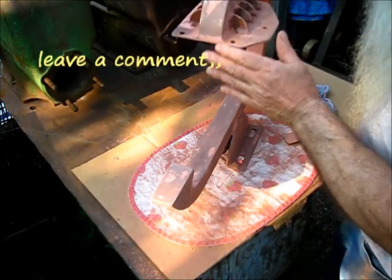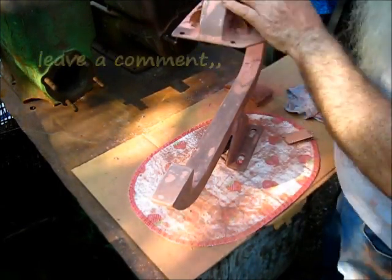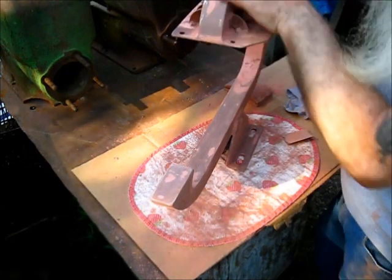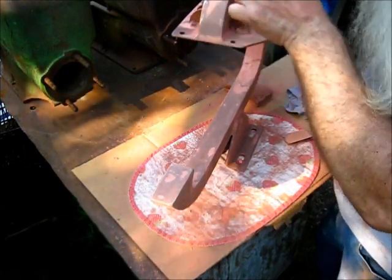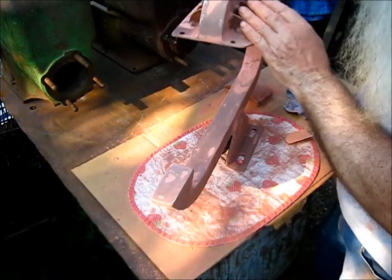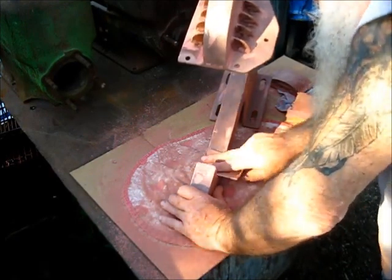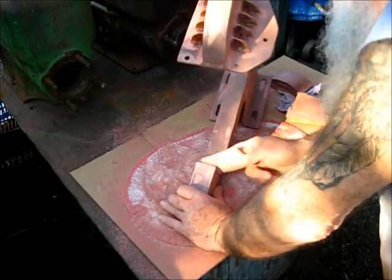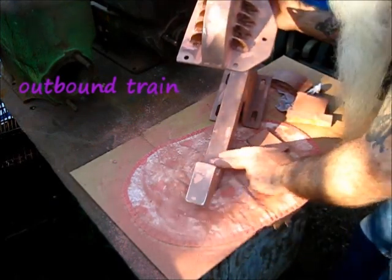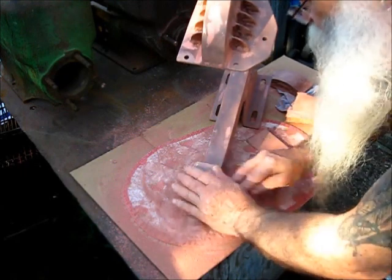Okay, now see right here is one of those areas. If we may go to school, this is one of those areas that is bordering on me sanding it too deep. It was a low place there, and I put some spot putty on it. And as I'm sanding it right there, it's feathering out real good, but it's getting lower than this part out here. So that's where you have to use restraint, and don't sand that no more. Okay. Now, you're not gonna be able to see that, but there's a low place right in that cup right there where that moves around. There's a low place. You know, I think primer would probably get to that too.